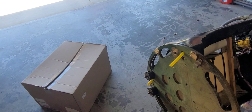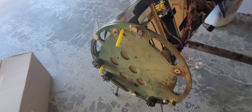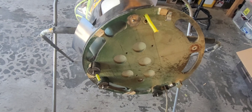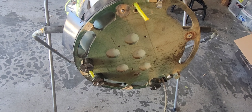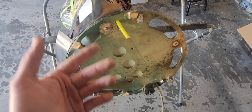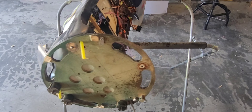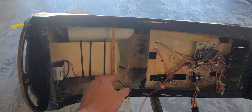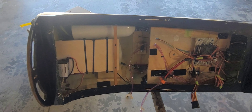The mount itself is securely attached to the fuselage, but with 20 horsepower hanging off the front and a huge prop, it's going to take some abuse. I also need to figure out servo placement and plan a change to the fuel tank. I've got a lot of work to do.